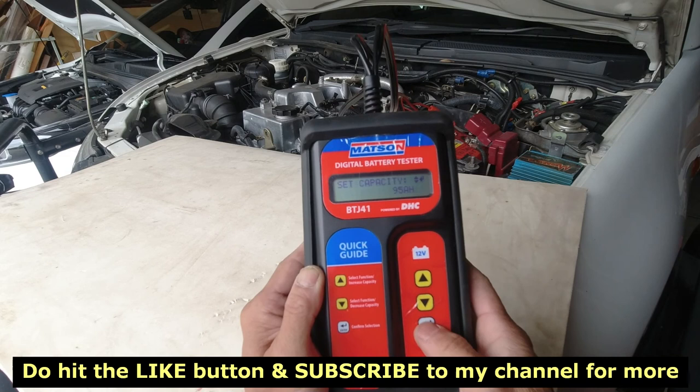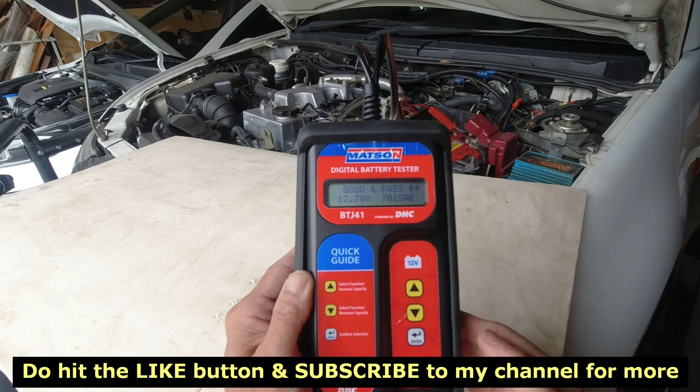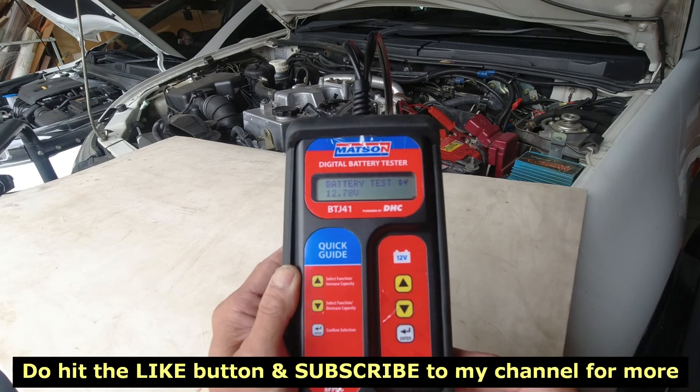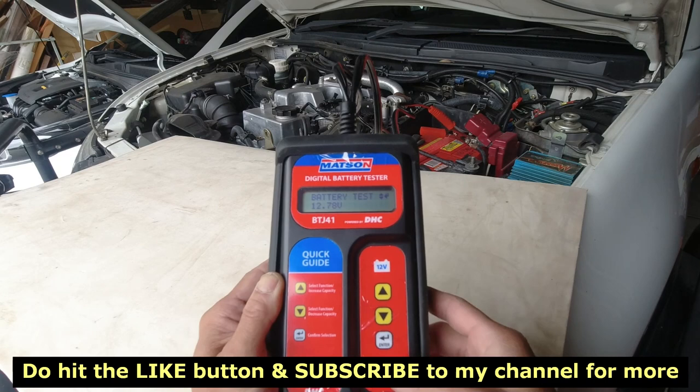And it's testing. And the results are good and pass. 12.78 volts, 701 cold cranking amps. Press enter. And that completes the test. And this particular model of the meter does not test the system, which means it does not test the alternator charging system. So it's a very simple to use meter.